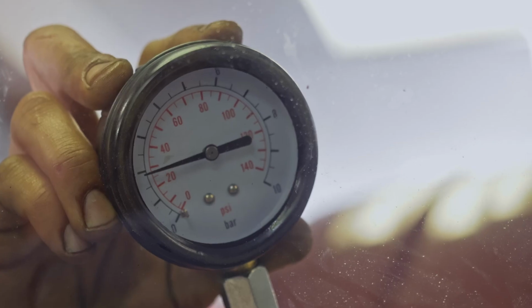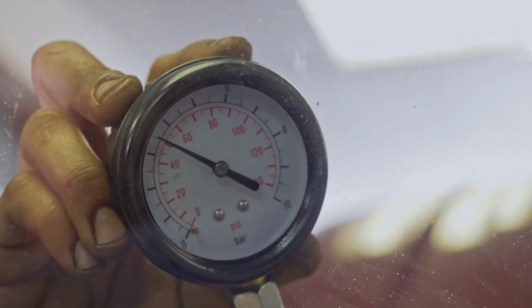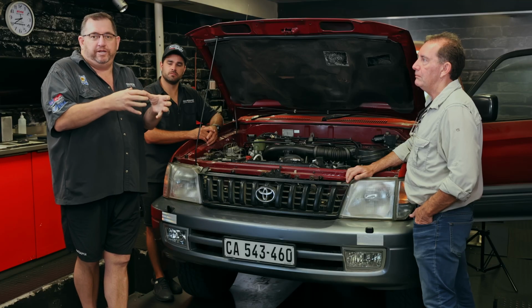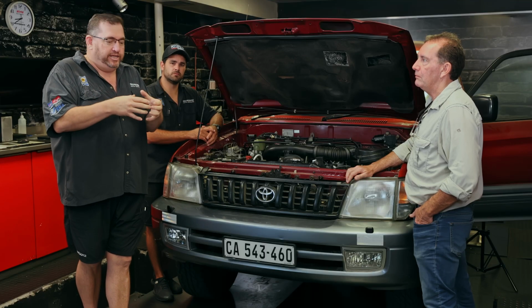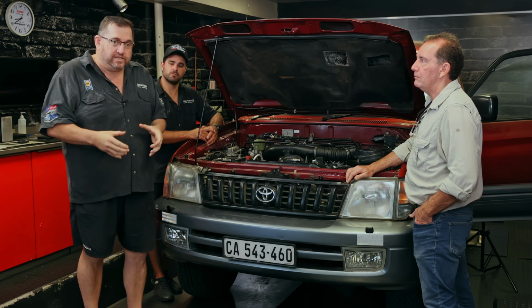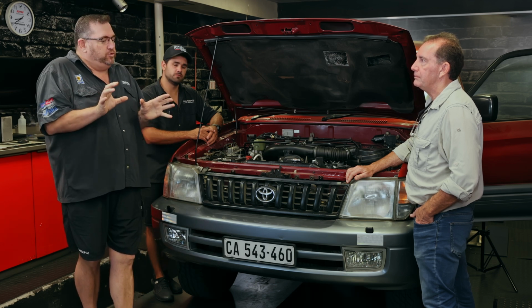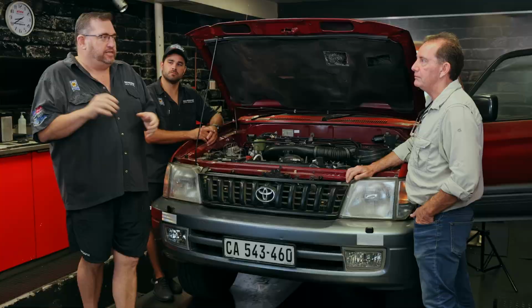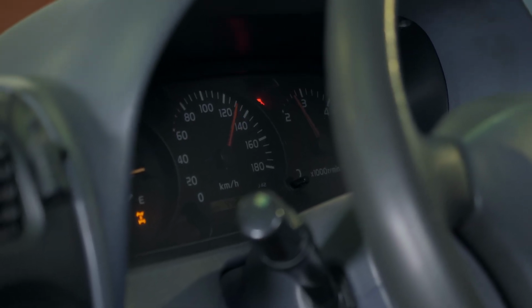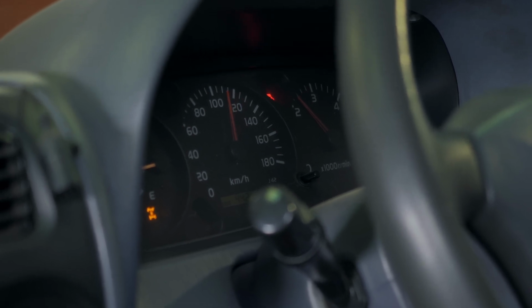So by applying different loads, what that means is Mark's going to be running it. He's going to activate the brake at a light load, then he's going to leave the brake. So when there's load applying, there's more pressure inserted on the rings. That's going to force the ring to open up and work on the cylinder bore. And then when you're off the brake, that force relaxes. You decelerate, it creates a vacuum which pulls the oil up from the bottom of the engine to cool everything down. So you try to do that at different speeds.